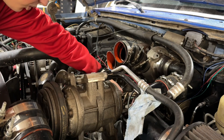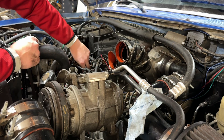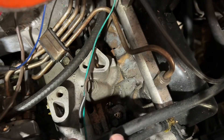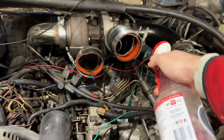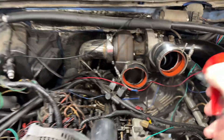Now I'm going to pull all these glow plug connectors off. I do have the bullet tips on here so they just pop off. Number two cylinder right here is going to be my first one. I'm going to clean down there a little bit — just some degreaser sprayed across there and wiped out with a shop rag.